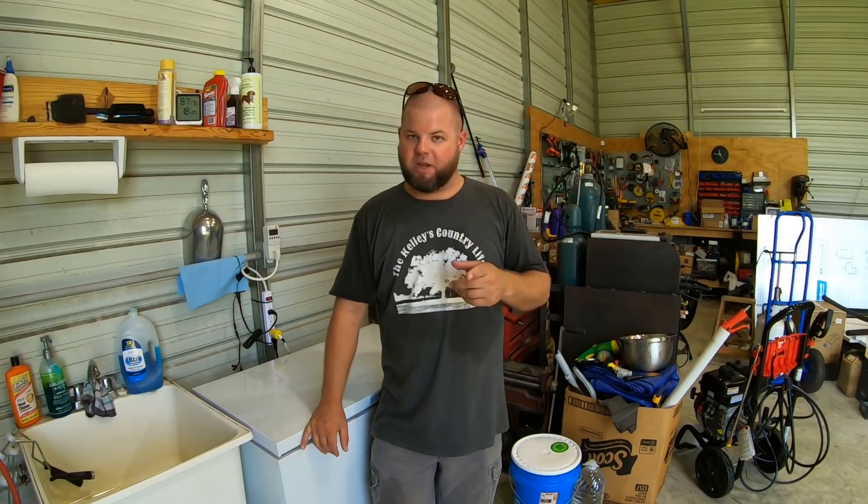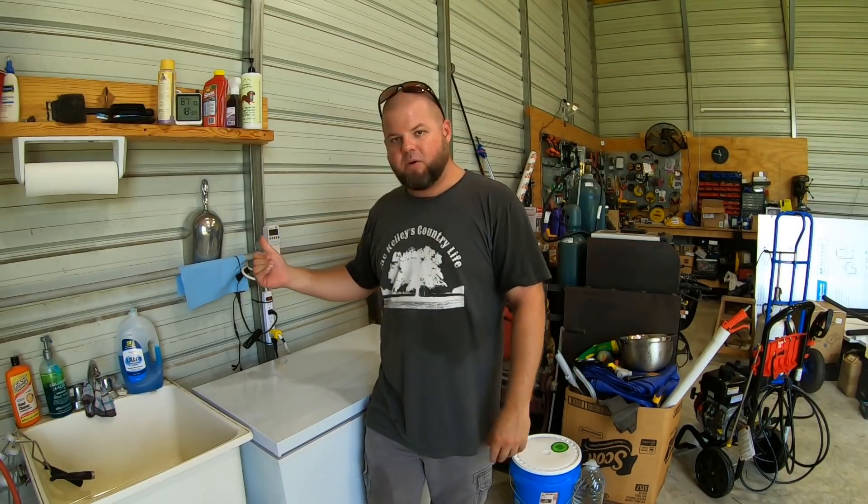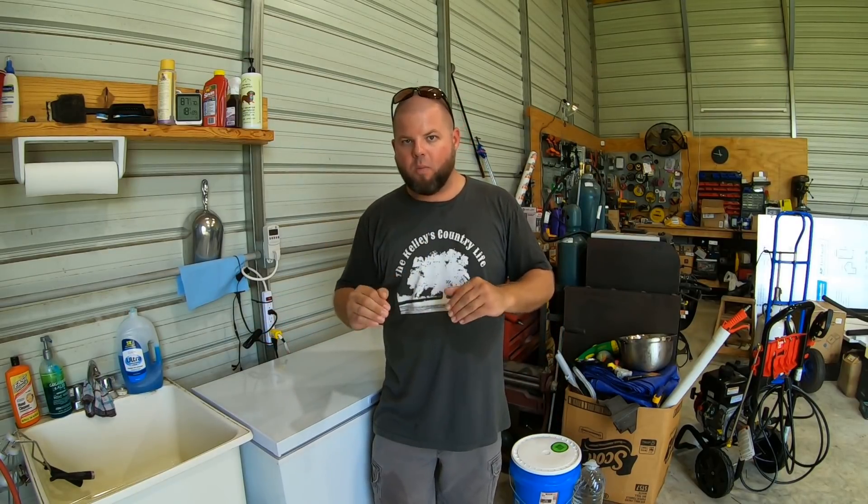I've already ordered a few more things for the next build — we're going to get a tremendous amount of air movement in there. It is going to come at a cost: kilowatt hour usage is up running a more powerful fan. However, I crunched the numbers: 0.22 kilowatt hours per pound of ice — practically nothing. Before we were getting 0.20 and 0.21, so only a slight increase, but our production increased.